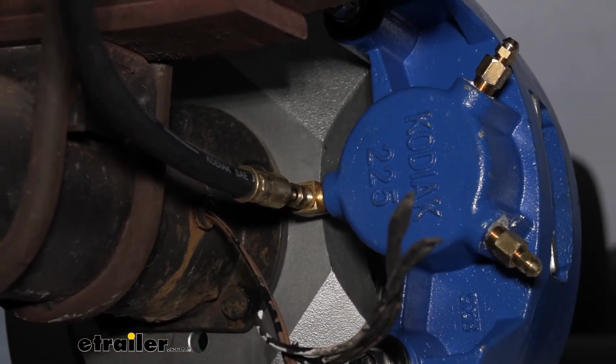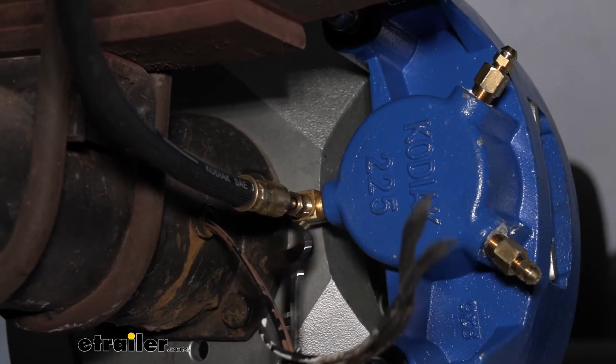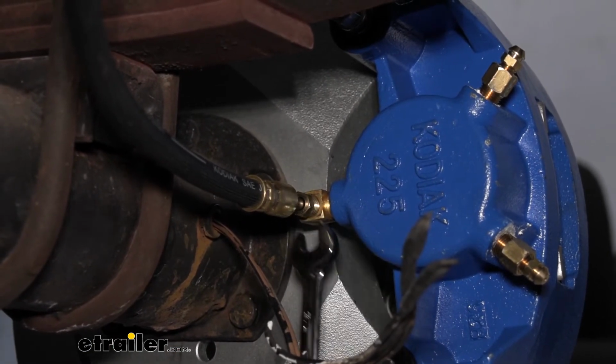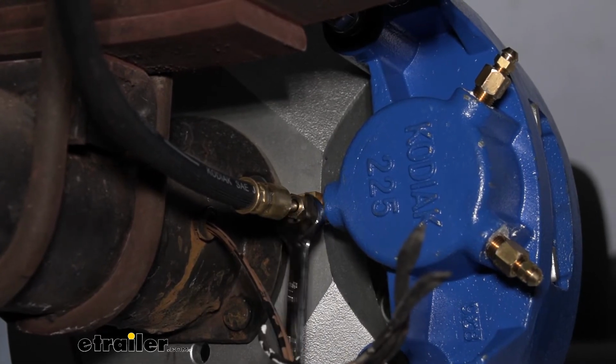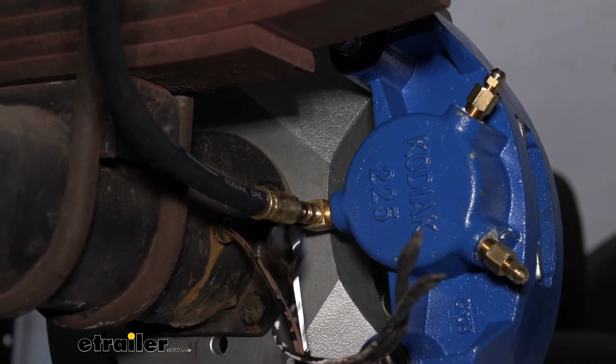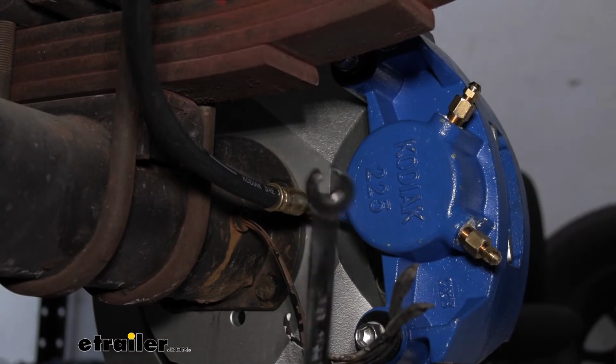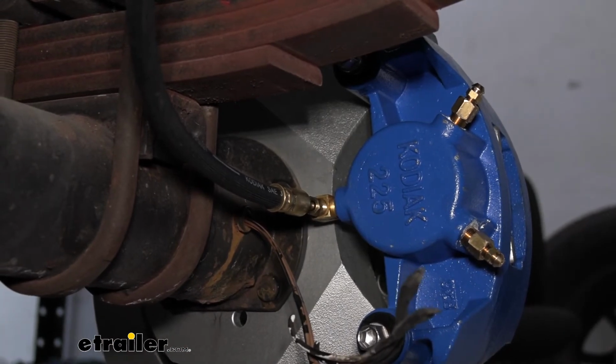Just like that. If we were to use that regular wrench, there's a chance we would have gotten it tight enough, but there's also a good chance that we would have damaged the fitting. And if it wasn't tight enough and you damage your fitting there, you may not be able to get it tight enough even with a line wrench at that point, because you've kind of ruined the structure of it. So definitely make sure you get the appropriate one. We're using 3/8 sizes for those.